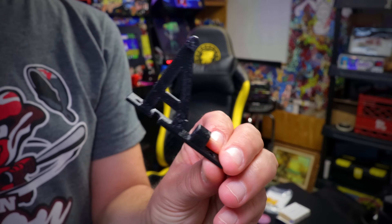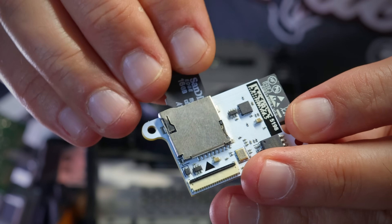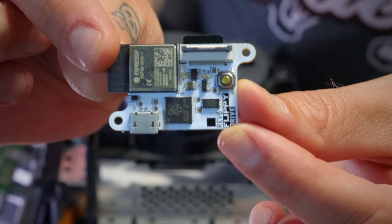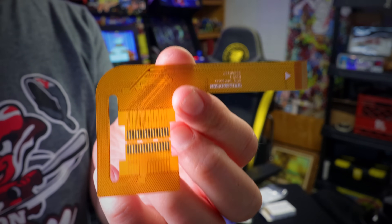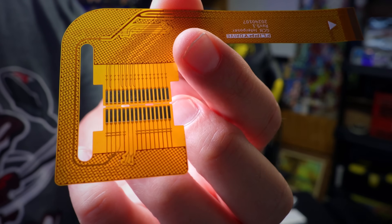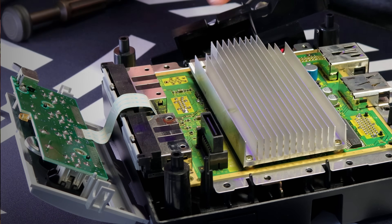Here's a little 3D printed bracket that's going to hold the drive itself, and four teeny tiny little black screws. With the Flippy Drive, you can see where the SD card reader is as well as the little part for the flex ribbon cable, and there's a little USB port on one side. It's literally a very flexible ribbon cable that has all kinds of traces pre-done — no need to install a million wires and solder all that stuff. The side with the arrow goes into the mod chip, and then this section right here is going to be the absolute trickiest part of this whole thing.